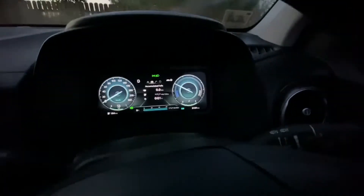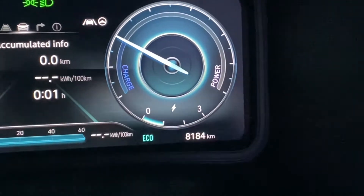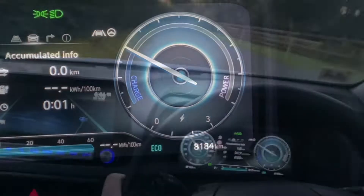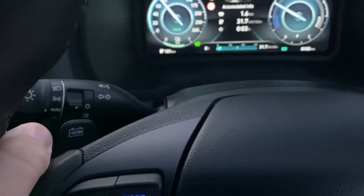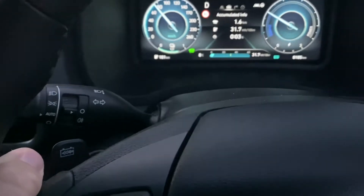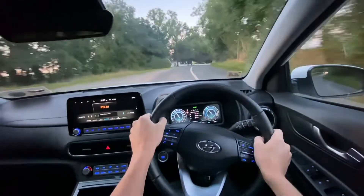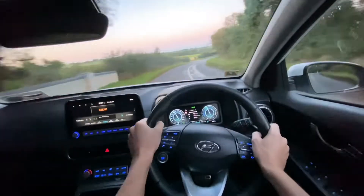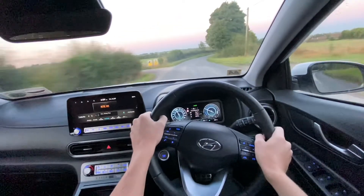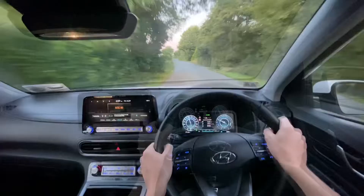The return trip - we're going to undo that level of regen, this is why I normally drive with literally no regen. In my primitive mind I'm thinking I don't have to fight the slowing up, I can just freewheel - I take my foot off the pedal and momentum continues to carry me without putting my foot on the pedal. In my head, in a normal conventional fueled car this would be an efficient way to drive, so it's the complete opposite of regenerative braking - I'm trying to freewheel as much as possible.